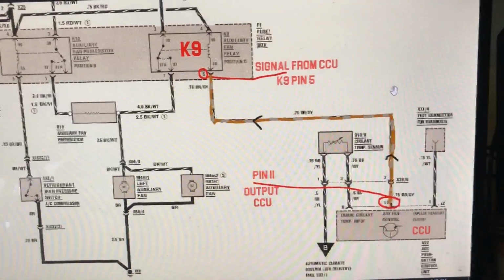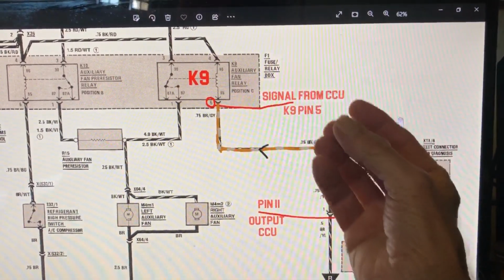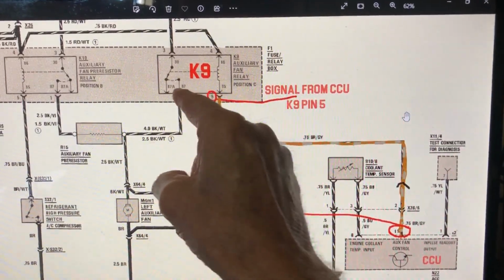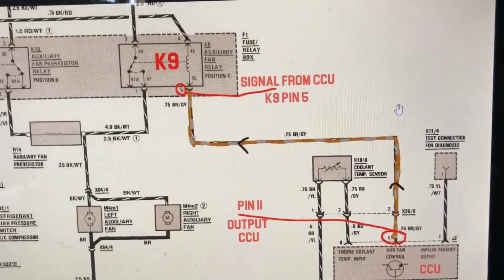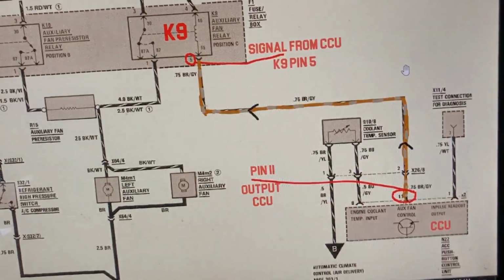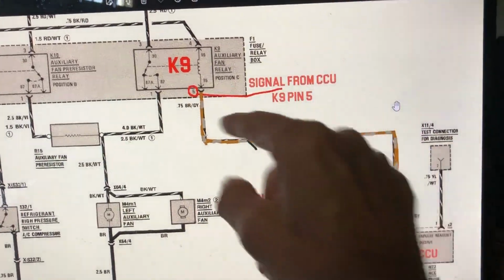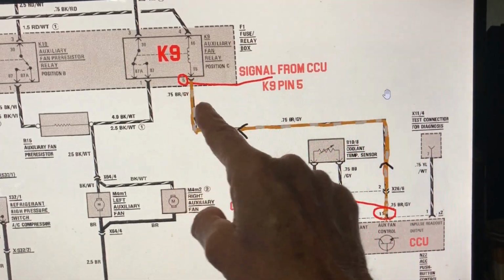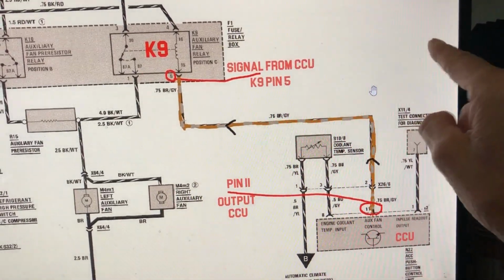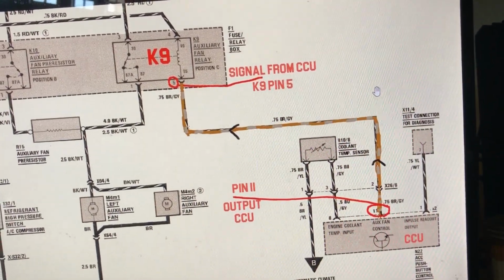I think that'll work. Some people will pull the relay out, and you have sockets, I think four on this one. In the sockets, they'll put a ground wire in and then jam the relay back in there, so basically you have a weird wire coming out of this thing. That is run to a dash-mounted switch, and the switch has a ground at the dashboard or something. So that extra wire will send the ground there and turn on the fans. People have done it that way.